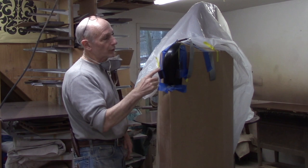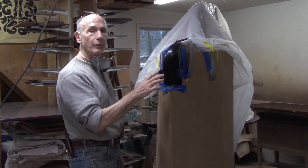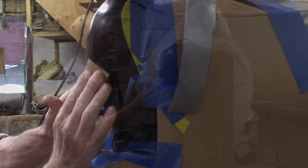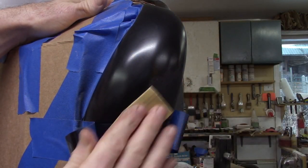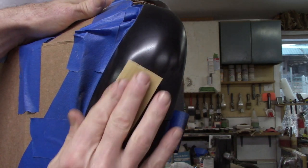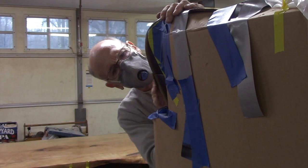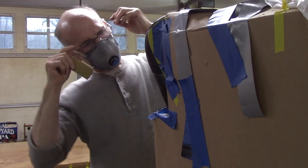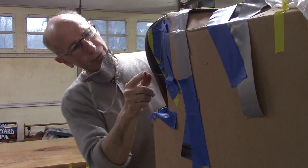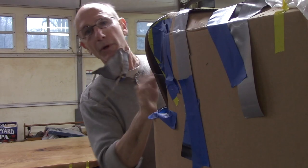I've sprayed a few more coats on it and let it dry overnight. It looks really good. My main concern was just spraying this with aerosol and how I was going to blend this in. It is a satin aerosol — it looks great — but I can feel it and it's not completely smooth. I need to sand it with some 500. I think I can remove the tape, sand this area, and spray it maybe just one more time. I do have a few little faint sand-throughs right there, which is a good thing because that means those were high spots.